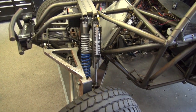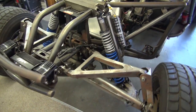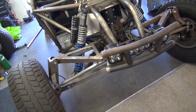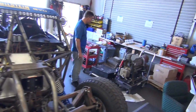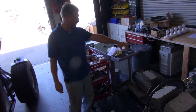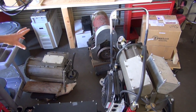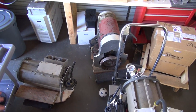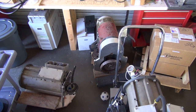As Henry's showing you the front of the vehicle, you can see we're doing a motor swap. In the far back part you can see these two motors on top of each other — those are direct current motors. That was EV 1. We were using direct current air-cooled motors, and we couldn't keep them cool enough.